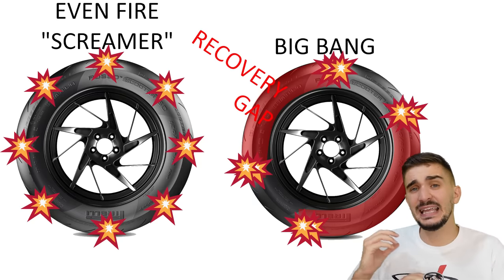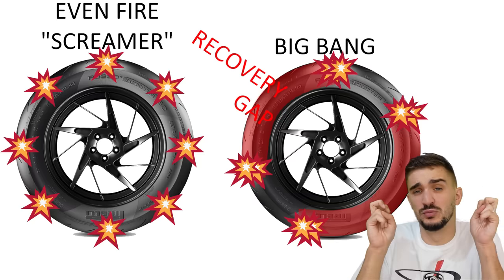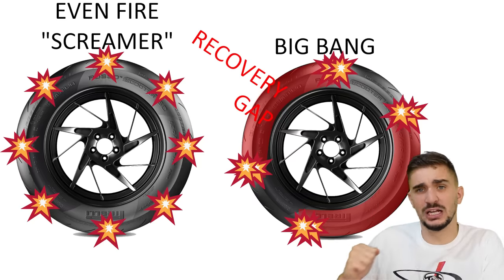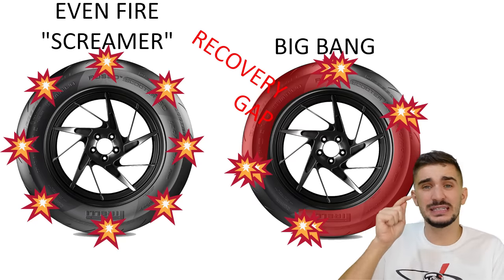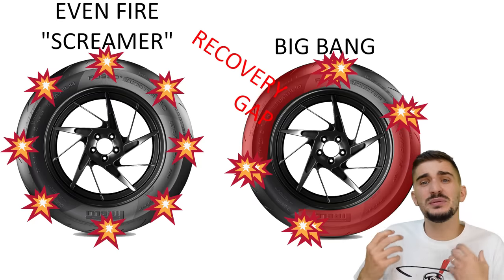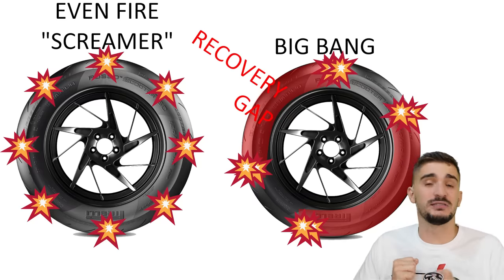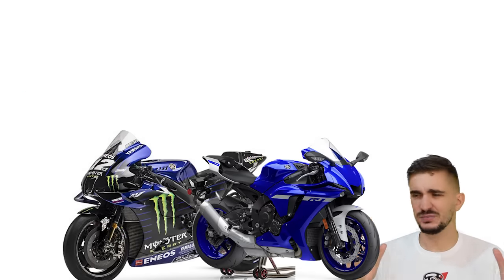In contrast to this, the even firing screamer engine isn't really giving the tire any room to breathe, if you will. It subjects the tire to a constant even barrage of power pulses. Obviously, this barrage of power pulses is also going to continue when the tire starts to slide even a bit. So it starts to slide a bit, power pulses continue, and they simply push the tire further out of control very, very quickly.